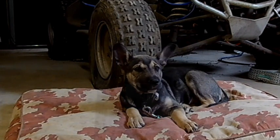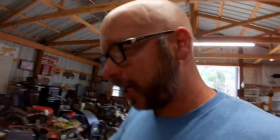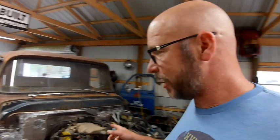Mudflap, is it lunchtime? All right, we're back after lunch. I've double checked all my scuffing, made sure everything's good, blown it off again. We're going to mask it, and then we'll do seam seal, and then we'll try and get some paint on it. Or maybe we'll seam seal it and then we'll mask it. I don't want to get into the seam sealer while it's wet, so I think we're going to mask it first. So yeah, let's do that.